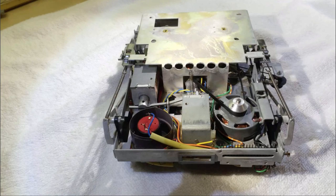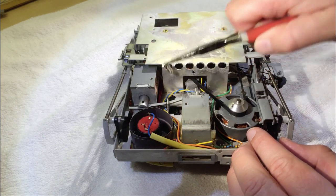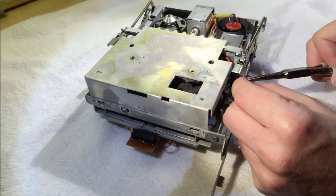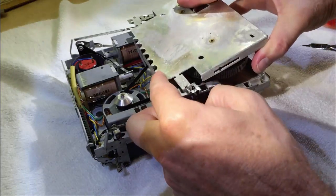I decided to exchange the belts at the bottom of the drive first. That's the main flat belt that drives the flywheels under this cover, and the small belt that drives the pulley that then drives the belt going to the counter. To take this cover off, there are three springs that need to be removed — one here and one on either side — and then a screw in the back. It's a really good idea to mark where these springs go so when you put it back together you know where they hook in.